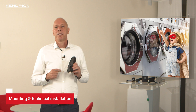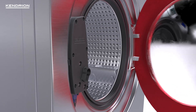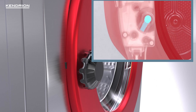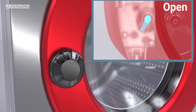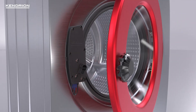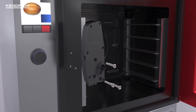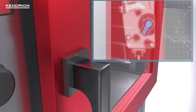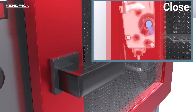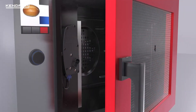A central connector makes assembly quick and easy. When closing the door, the hook which is mounted on the door slips into the door lock. The door is closed when the doorknob is turned 60 degrees counterclockwise. This function is fulfilled by a curve in the plastic housing which presses the door approximately 4 mm into the door seal. Closing forces of up to 400 N are possible thanks to the use of high-strength glass fiber reinforced plastics. This ensures a secure seal protecting against machine leakage.